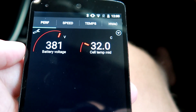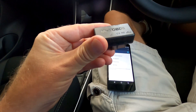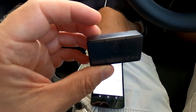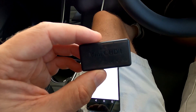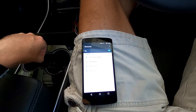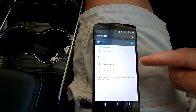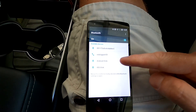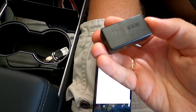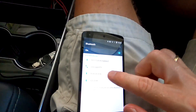I've got ScanMyTesla — Tesla Watchdog — running on my old mobile phone now. I've taken out the mini OBD2 adapter which came with the ScanMyTesla wiring harness and plugged in the V-Gate iCar Pro 4.0 Bluetooth to see if we can get this to work. The first step is to go into your Bluetooth settings on your mobile phone — I can see the Android V-Link, which is my Bluetooth adapter. This one shows up as OBD2.